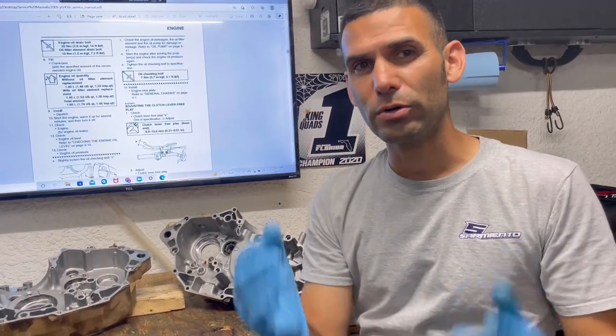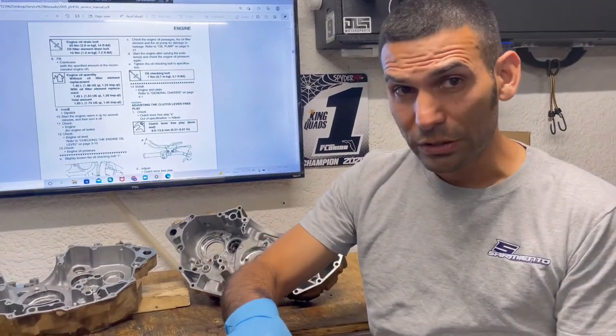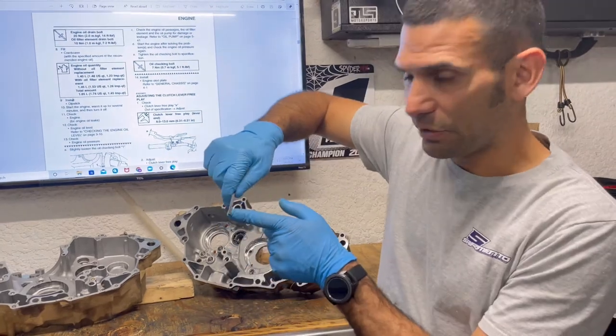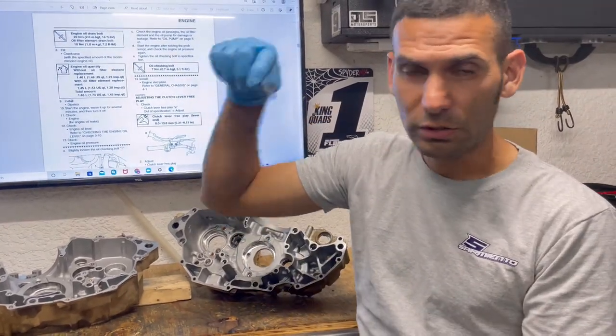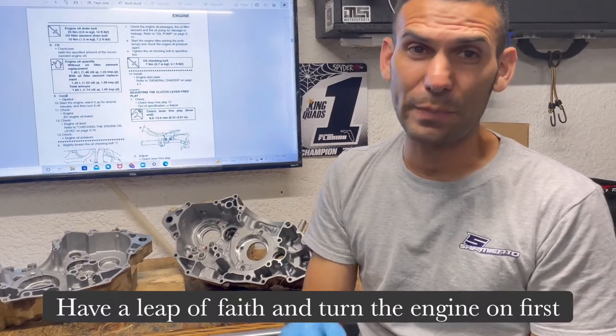That's why on the instructions, and also, it's not uncommon when the motor is cold, when you go to first check your oil, cold engine, sitting overnight, you pull the dipstick, it shows, man, there's nothing here on the dipstick. Where did it all go? Don't fill it with more oil, because you're going to overfill that thing. And a lot of people do.